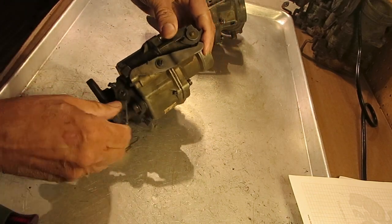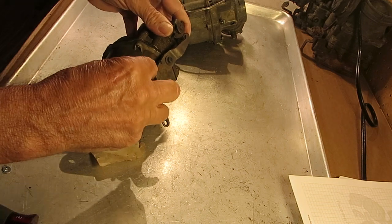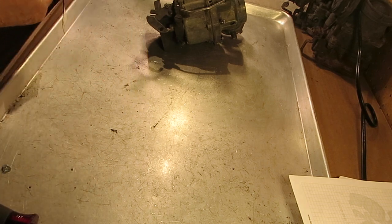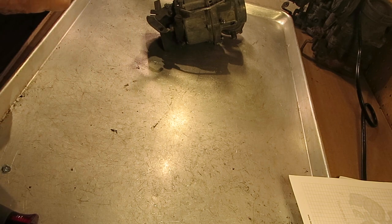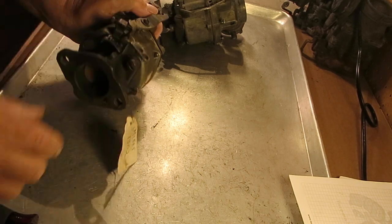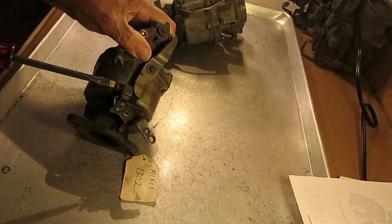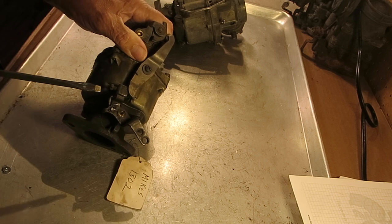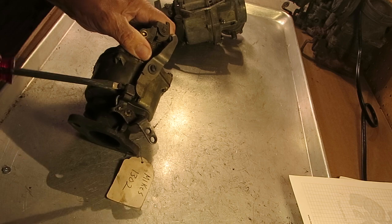So when it's open, right here is the idle screw, and the valve is closed down here. It's all closed — you can see very little air around it, and actually it's a little bit open. So to get it all the way closed, I'm going to screw out the idle screw a little bit, because that's holding it open.